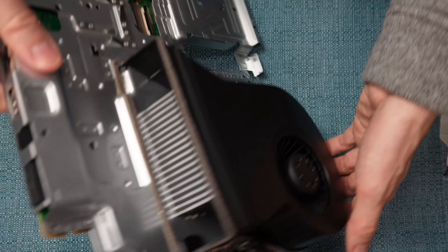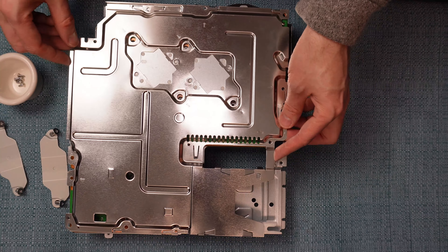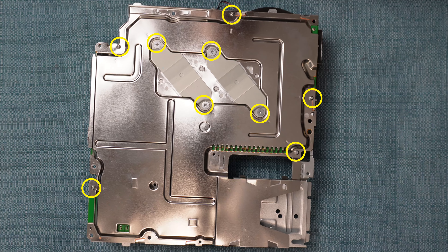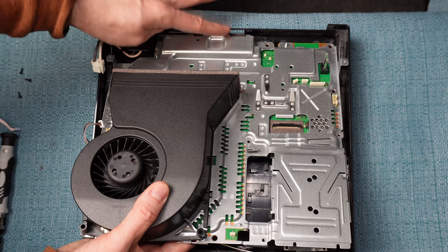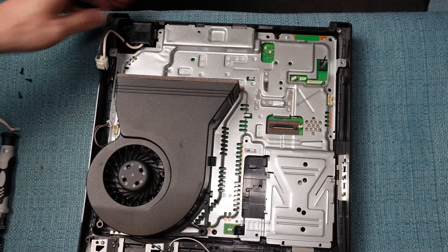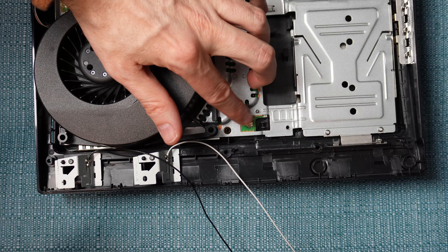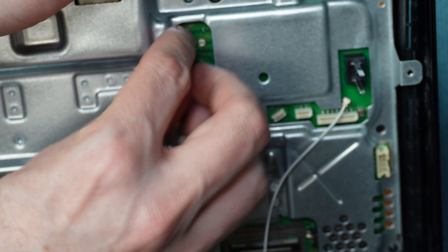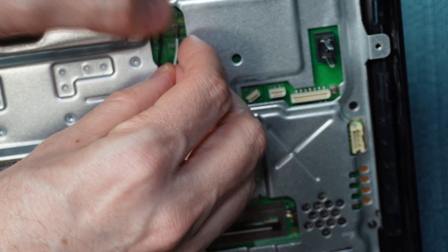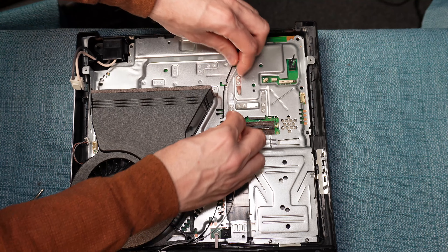Here's how to put everything back together. Take the metal panel that has the fan on it and slip it onto the board, being mindful of the ports on the side. Then place the other metal panel back on and put the nine screws back into it — there are little arrows on the metal to indicate where the screws go. Place the metal box into the bottom half of the console shell, then replace these five screws — two are silver and the rest are black. Reattach the ribbon cable that goes to the button panel, then reattach the black and white wires. They won't snap back on unless you position them perfectly — the black one snaps into the spot closest to the fan. Snake the wires through all the notches.